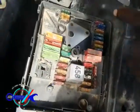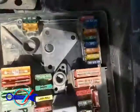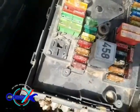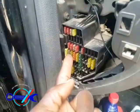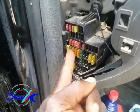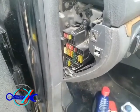The fuses I found to be culprits are this 15-amp fuse and this one here — if you look carefully, that is actually the fuse responsible for the ECU. The other culprit I found is on the inside: a 20-amp fuse. If you count from the left, the first big fuse on the first row — that very fuse controls the central locking.